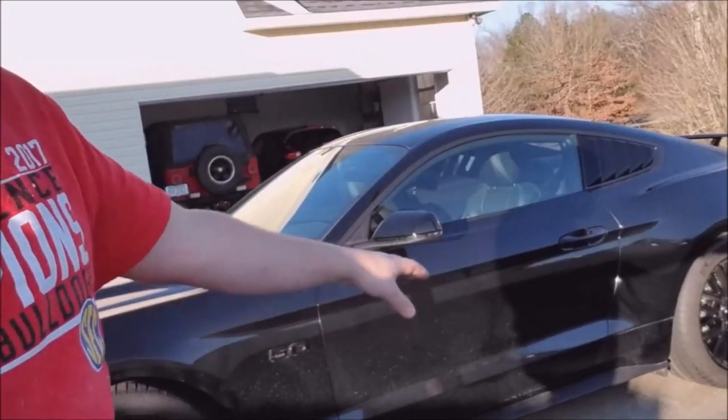This is the Steeda jacking rails portion of the video. It took about an hour total to install. Really wasn't that hard — you really can't go wrong with it. If you're having trouble getting it lined up flat, you're probably just running into some seam sealer. Scrape that off, spray some paint on there, and you'll be good to go.